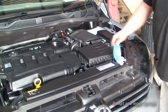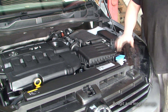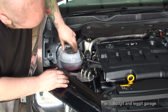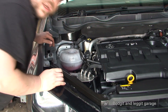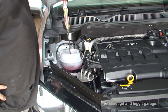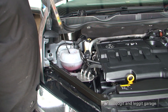Now I've got the cover back on — I'll just give it a bit of a polish. We have a nice clean engine. All I'm going to do is top up the windscreen wash — I've got screen wash in the water, it's more or less full anyway. We'll still check the brake level: the brake level's good, even though it's more or less a brand new car, but you never know. The water level is just below the minimum, but before I top it up I want to check the antifreeze is okay — and it's good for minus 37°C, so we'll be good at that.